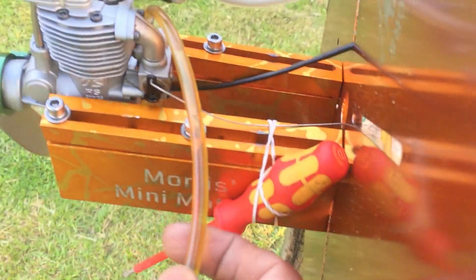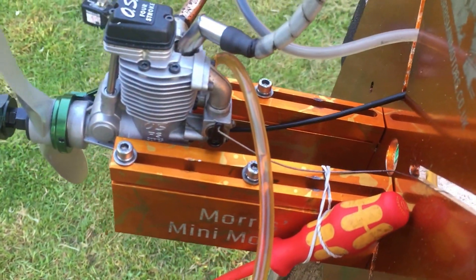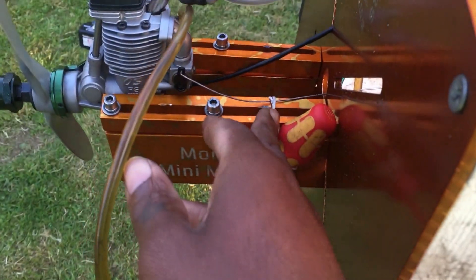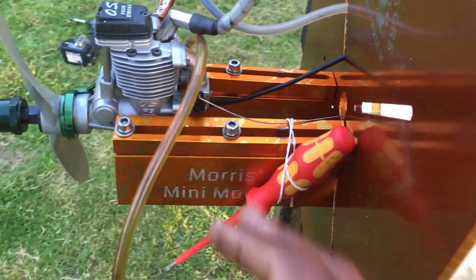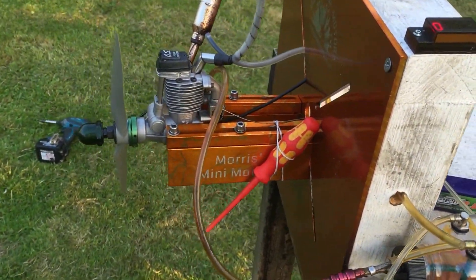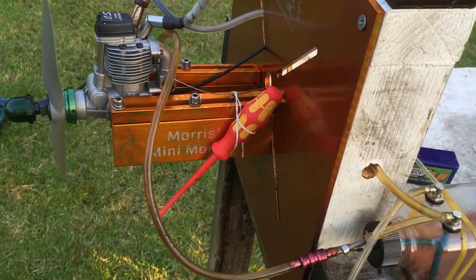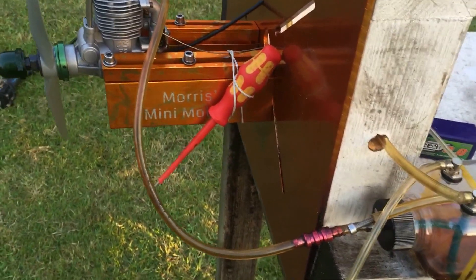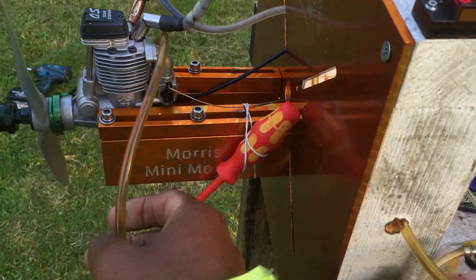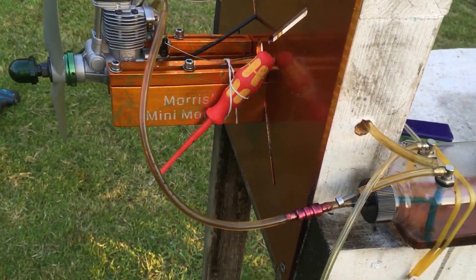That's a big bubble there. Let me feel the line right there — I can't really hold it. I put this rubber band there to kind of hold the throttle a bit more firm. When I started it, the idle is a bit rough. But when I do get the bubbles out, I do get the idle right down to 1,600–1,700 steady.